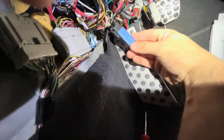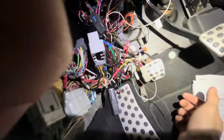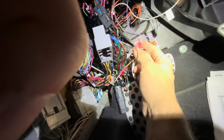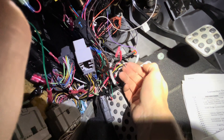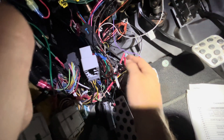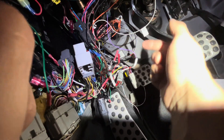We got our three wires here, so pull them through the firewall — and prepare yourself to see a mess. It's actually more organized than you think. I have a lot of these, and it's hard to see with the shadows, but this is my sensor ground plug — all my sensor grounds go in here, everything is labeled with tags so I know where everything's at. Right now I have a pull-up resistor here because it was on an analog input. Since we're moving the bump button to a digital input, we shouldn't need the external pull-up resistor — on MaxECU you can tell it to run a pull-up internally inside the ECU itself, which is really nice.